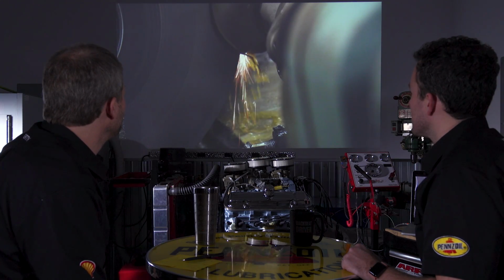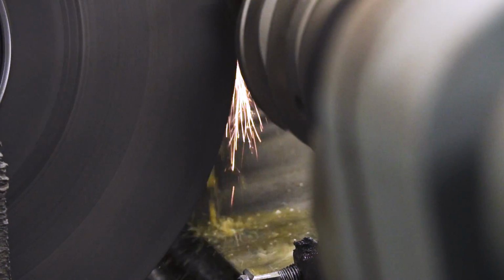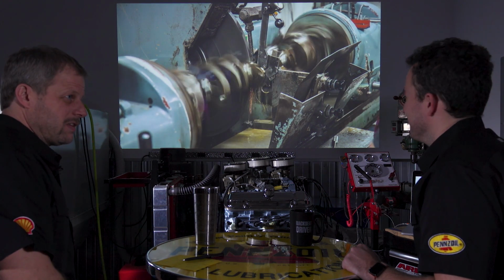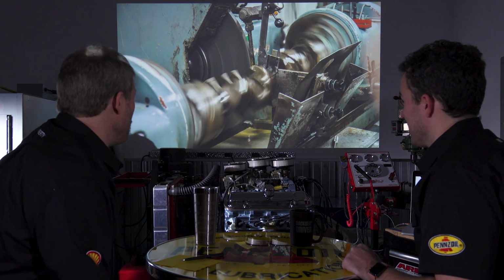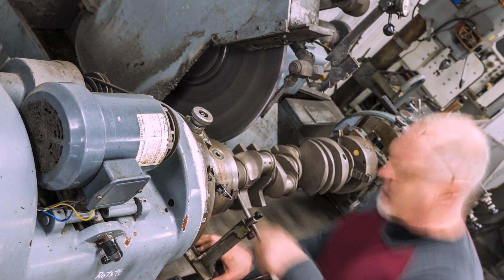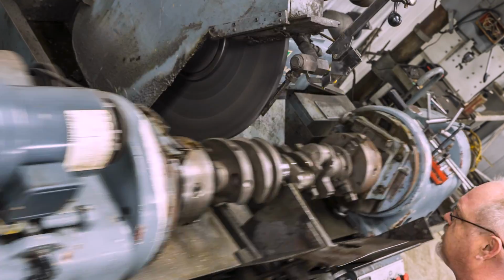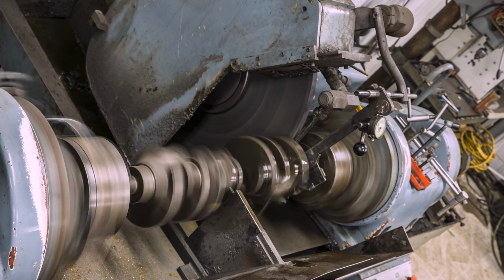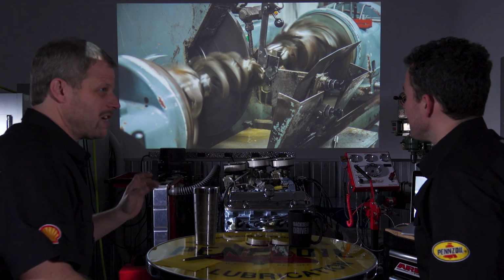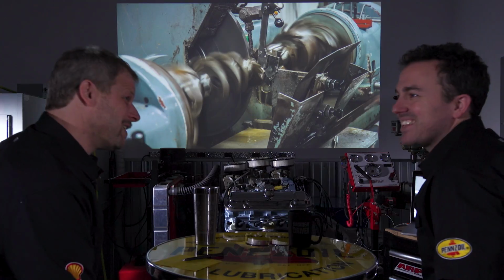And now this is something new for us. This is the first time I have ever watched a crankshaft being cut and then subsequently polished. Just when I said grinding stones aren't accurate, this is the way they are done. They are done with a grinding stone here. A big grinding stone. A very big grinding stone. And it's spaced and so on and so forth. Two separate styles of operation. This grinding stone would be capable of setting not only impressive surface finish, but also size in the millionths. Oh, really? I didn't realize it was that accurate. Oh, yes. In fact, to get you at perfect size, you run until spark out, so it basically stops sparking. Okay. A side note, I remember that from my engineering classes. Maybe some of the only things.